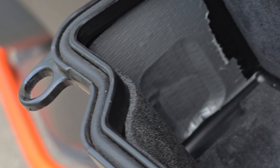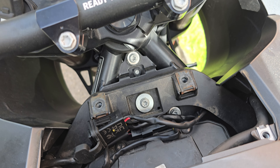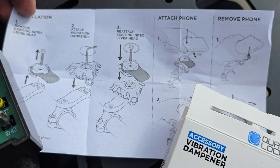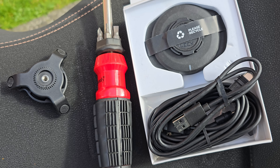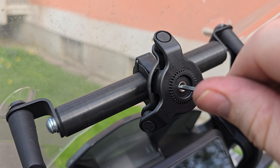You have to remove the USB port from the case. This can be done by applying medium pressure in both directions from the outside. There is a rubber isolation of the USB port which gives a bit of flexibility, and after this you can push it to the inside. Now, first you have to mount the vibration dampener.